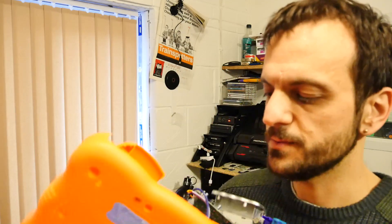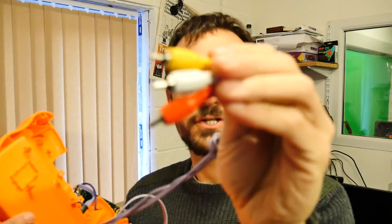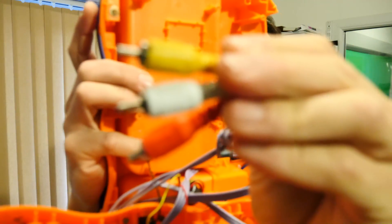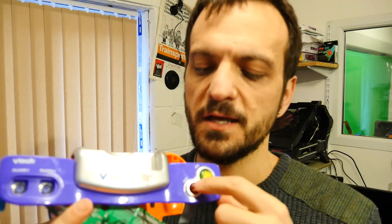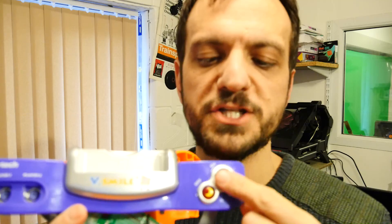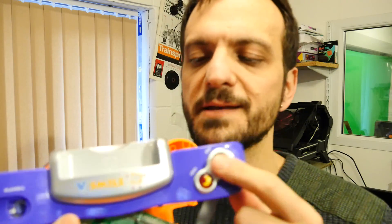After studying this for some time, I've made certain discoveries. I'm going to see if I can keep the composite connection - traditionally Raspberry Pis did allow for composite, so I'm going to see if I can keep that. I'm going to try to keep the on-off buttons on the front and re-task those, because you don't really have on-off on a Raspberry Pi - it's permanently on - but I'm going to re-task them as probably a reset button and a spare GPIO, so maybe when I hit this button it'll always take me back to the menu, hooked up onto general purpose IO lines.